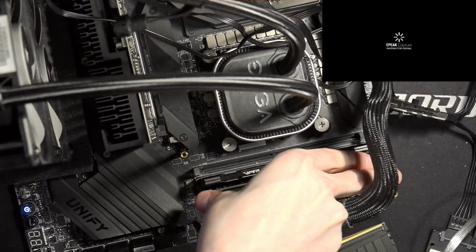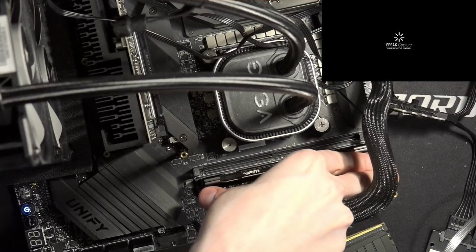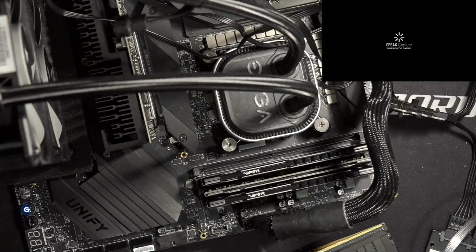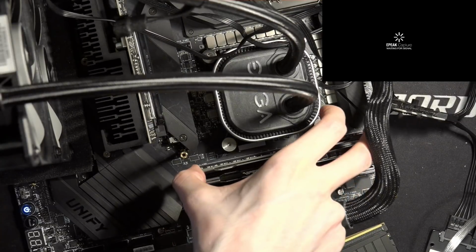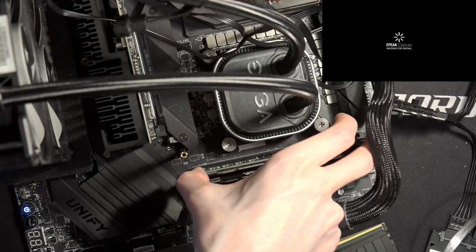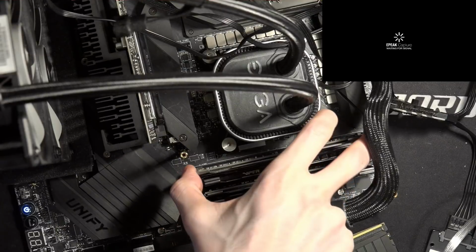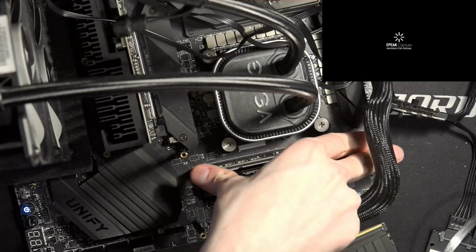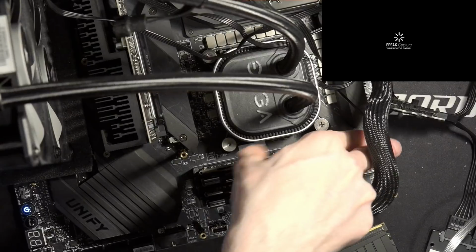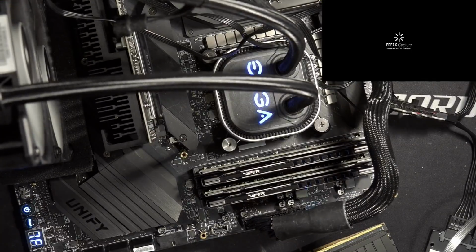And at this point, you're probably wondering, what would happen if you took those dual rank DIMMs and mixed them with the single rank DIMMs? Would you get triple rank? And the answer to that is yes. Is it a good idea? Not really, because the PCB differences between the DIMMs lead to annoying compatibility issues when overclocking, and just generally weird behavior. But technically speaking, triple rank is a thing. The only reason you would ever want to run it is if for some reason you want 48 gigs of RAM, but 64 is too much. Or if you just have a bunch of cheap mismatched RAM lying around. That's the other option for running that.